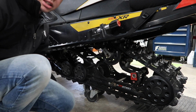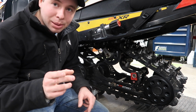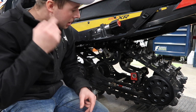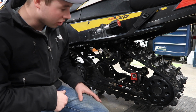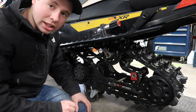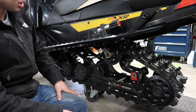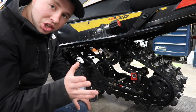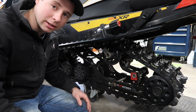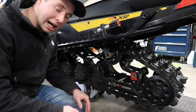That means that your rear shock, if it's an X package, your X packages, you can rebuild the suspension. We'll get into that after on the packages, but you're going to know that you're going to be spending a couple $100 to get your shocks redone if your suspension is sitting back like that. So other things to check are obviously your wheels. You're probably going to have to do bearings, and it depends if it's been serviced or not, but just think of it that you're going to have to do them.